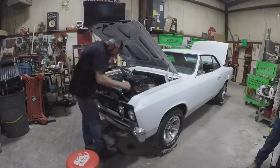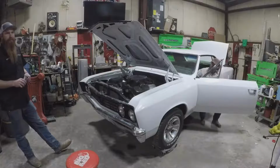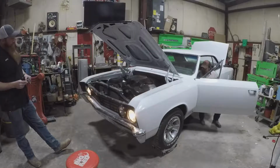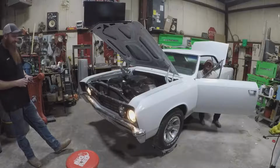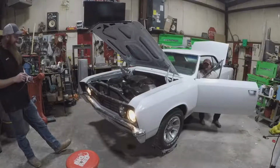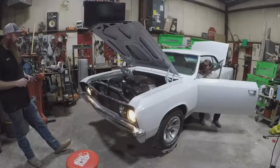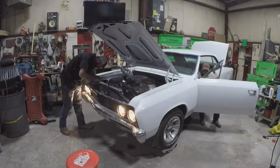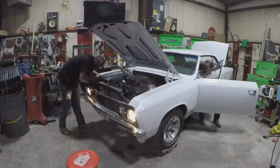So you got that grounded. Go ahead and see what happens. Okay, we got brights. Something seems backwards. We got a special needs car here. That's cute. I love it. I think you should leave it. What's going on now? The inside headlight on the passenger side's on, and the outside on the driver's is on. That's not normal, right? It's not. Is the headlights just swapped around wrong? I think that could possibly be. The brights are all right though. Yeah, all 4 of them are on, so maybe your switch isn't bad.